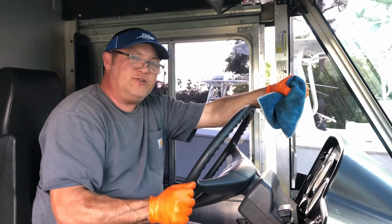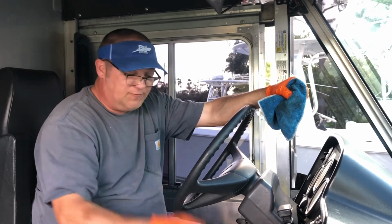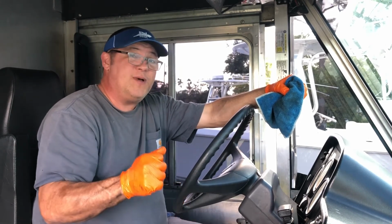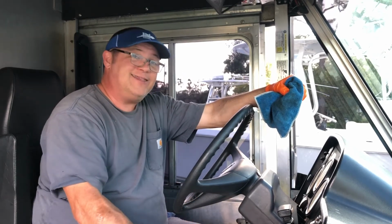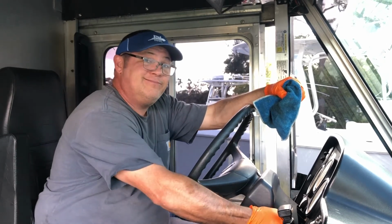Notice how the motor didn't surge or go crazy on the first fire up? It's because I put the fuel filter on dry. I let it cycle the key long enough that I could listen to the fuel pump, with my engine cowling off. I can hear the fuel pump start loading up, and once I hear that fuel pump load up, it actually changes the pitch of the sound. I know my fuel filter should have fuel in it at that time. I waited till then, I cycled it one more time just to be on the safe side, and fired it up.